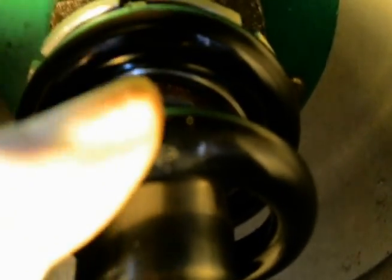It's not coming from the bottom. It's coming from the top of the spring where it meets the perch. The perch is that silver, like flat ninja star looking kind of thing. There it is. You can hear it real nice there. Now all this is basically a little bit of play that develops over a while of having the coilovers, hitting potholes, and you're driving in the street, so honestly they're not really for the street, but what can you do? So here I'm just greasing everything down,